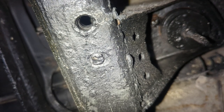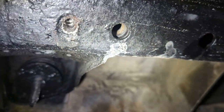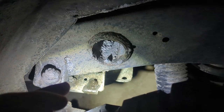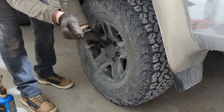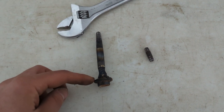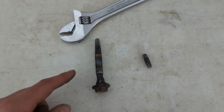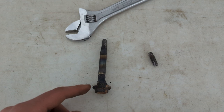Quick bonus — I've got my extractors and I'm going to take these two broken bolts out. I already attempted this one before painting but the hole didn't get drilled center, so I'll have to pull that one out a different way. I have a decent hole now but the drill bit I need is starting to flatten and I can't get the extractor up in there. The other one has been soaking in WD-40 so I'm going to try to pull it out with pliers through the top. I was able to get the gas tank skid bolt out, but I welded a nut to the other one, broke the welds many times, and eventually just ground that bolt flat with the frame and left it — I'm not going to use it in the future anyway.